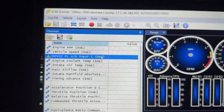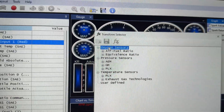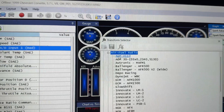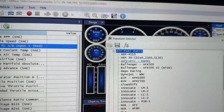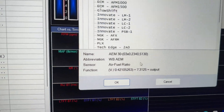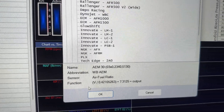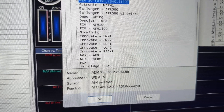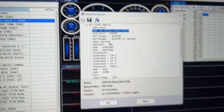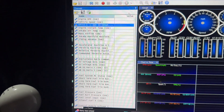We're not done quite yet. Right-click on the channel and go to Transform. You're going to see oxygen sensors and air-to-fuel ratios — double click that. You'll see AEM 30-dash and then a number. Click it and you'll see down here it does the conversion for you, converting your voltage from the gauge into an air-to-fuel ratio. Select that, click OK, and now everything should be set up so we can start data logging.